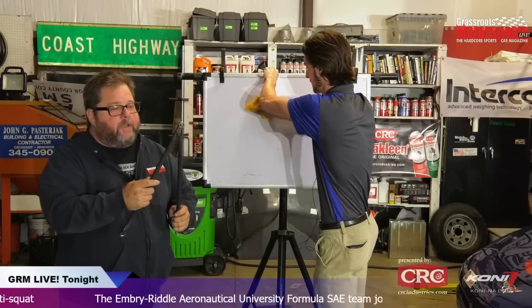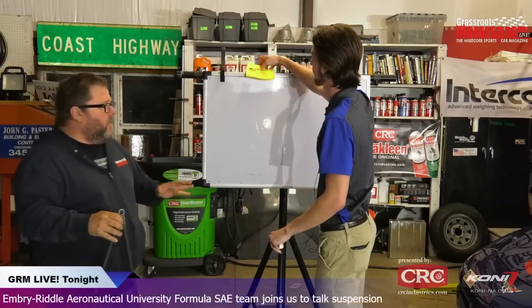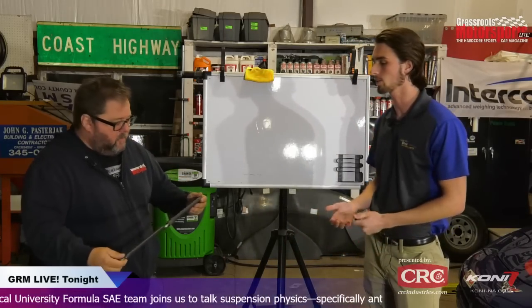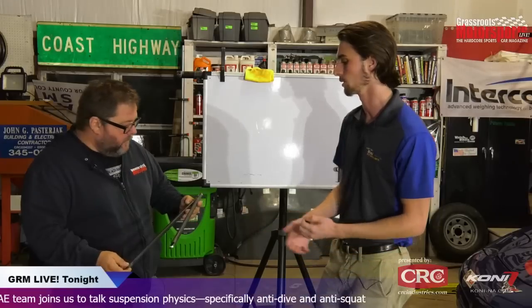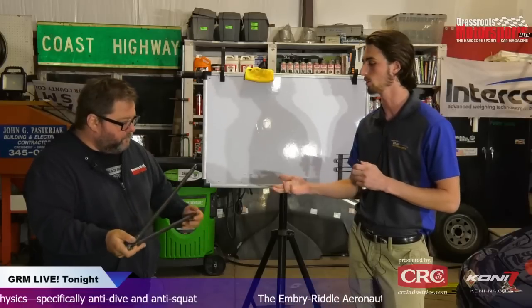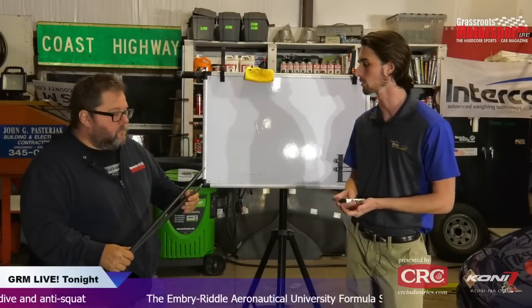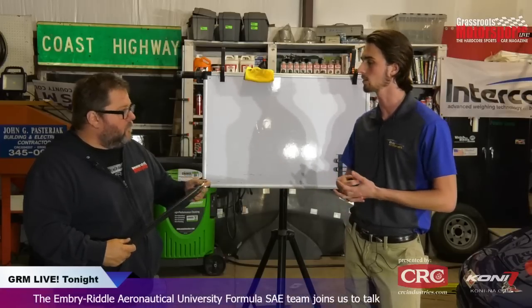When it comes to building and designing these things, it's all completely 100% student-led and designed and built, right? Yeah, so we have manufacturers that help us. For example, these parts right there, the forks on the end that hold the bearings, are waterjet by a company near us, and then post-machined to a very tight tolerance with a chamfer that's specifically for those bearings. But the assembly all happens by us, so that was welded by Chandler, our team lead.